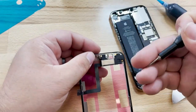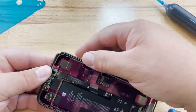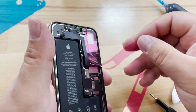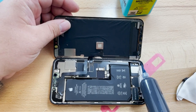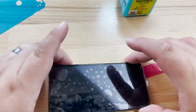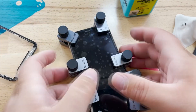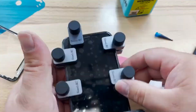For these older models where you had to destroy the bezel, a new bezel needs to be installed, versus the newer models where there are ways to get around messing with the bezel. One of the easiest ways to align and secure the bezel is to install it back in the phone. There are jigs for this as well, but here's a technique — let me know in the comments if this is something you do. We'll connect the display and add cold press adhesive around the border, taking time to make sure I have the perfect amount around the entire perimeter. We'll line up the display, close it down, and then strategically place clamps around the perimeter, ensuring the display sits nice and flush with the bezel inside the frame. Then I'll carefully move the clamps one by one and clean any squeeze-out of adhesive before it has time to fully cure.